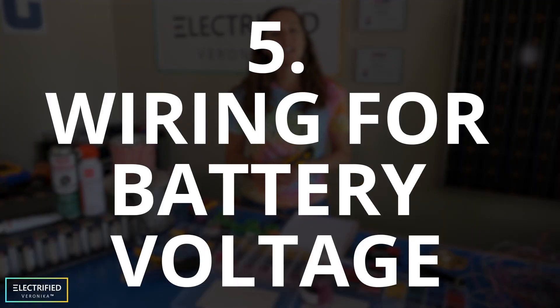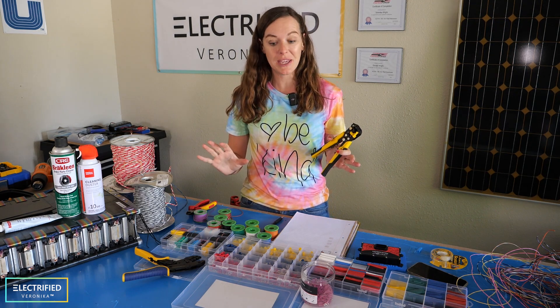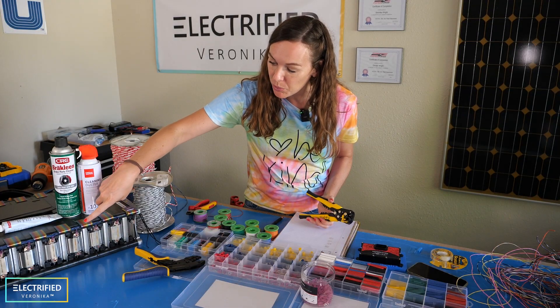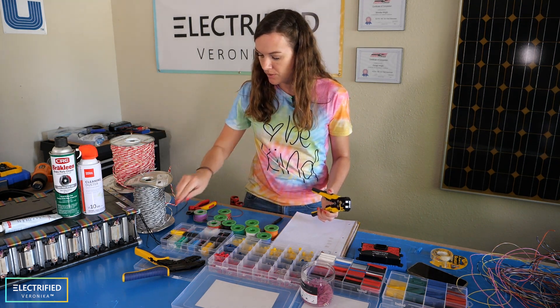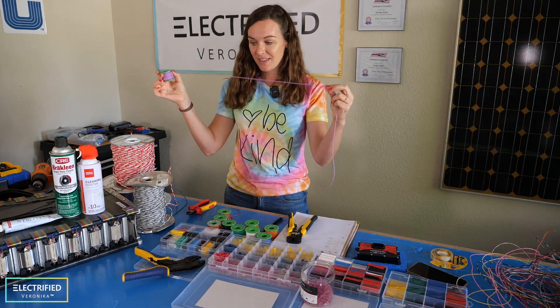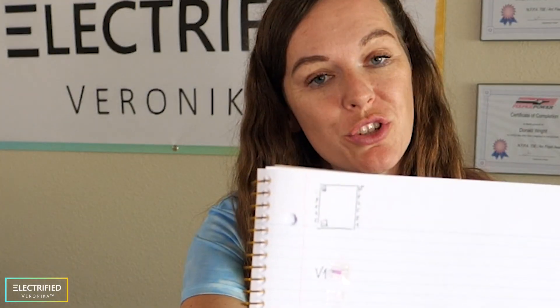Now I will make all the little wires needed for our battery module — one of my favorite tasks. I love making wires, and every connection gets a different color. We will be measuring 16 cell voltages as well as three temperatures, all connected to the battery management system by AEM. Each pin measures either a voltage signal or a temperature, and the color coding lets me remember which color corresponds to which voltage.